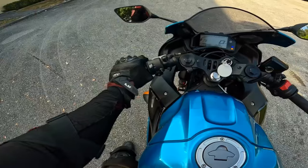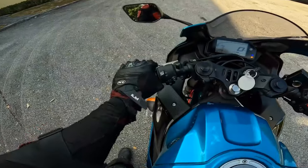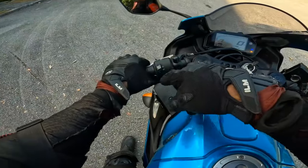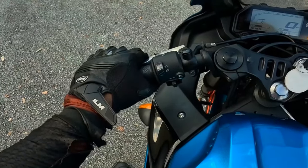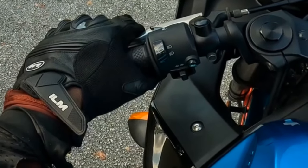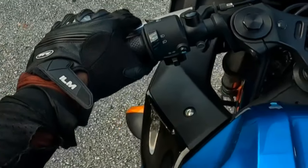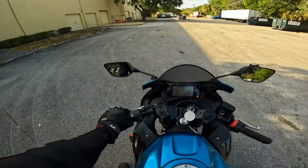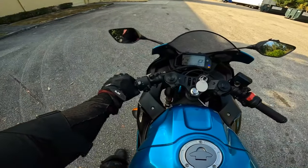As I start to release, the bike starts to move, as you can see. Look at my hand, and if you can see that whole gap, I'm going to slide my hand down. You see that whole gap? There's no gap right there. We're going to go as we start to release. I'm still not moving. You hear the RPMs kick up. The bike is starting to move now. So that's where I know where my friction zone is at. And that's where I know to either get the bike moving or take power from the rear wheel, that's where my fingers need to be.